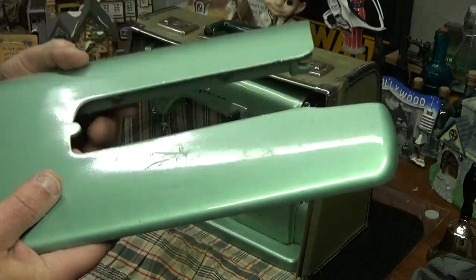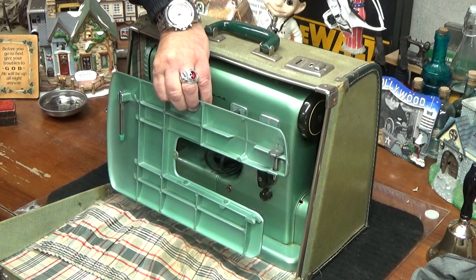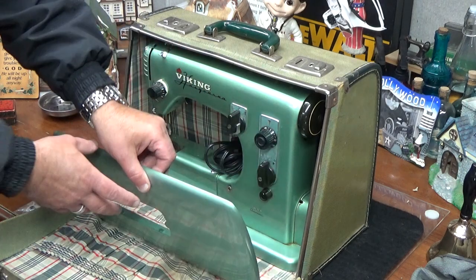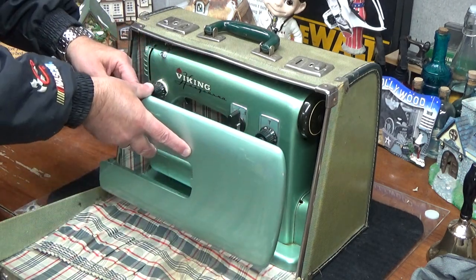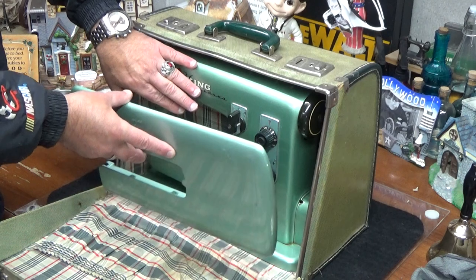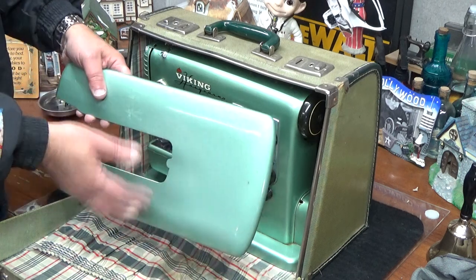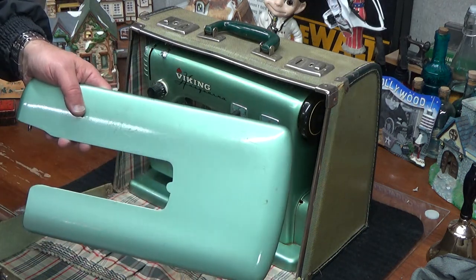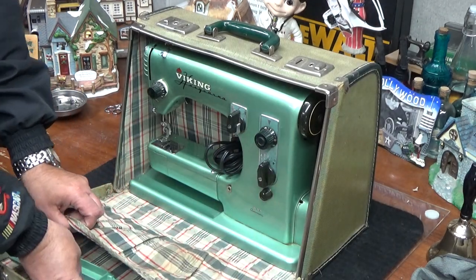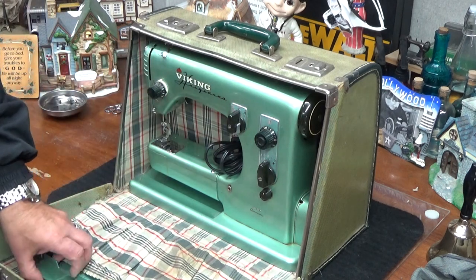So a tip, if you're going to ship one of these, don't ship it with it facing this way. Ship it facing this way, and preferably you're going to do some sort of stretch wrap or something like that around this machine so that if this is having incidental contact with it, it's not going to damage one of these knobs if it takes a big hit, or scratch the plastic surface of these knobs either. You always want to have a buffer, otherwise you get something like this. So I'm going to put it back in the case properly, and that's the way you want to ship it, like that, with some sort of a buffer. Okay,